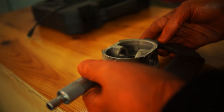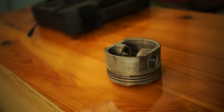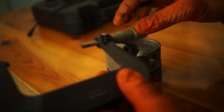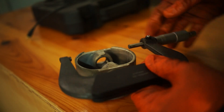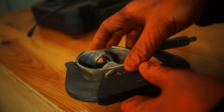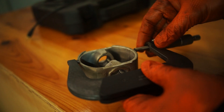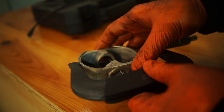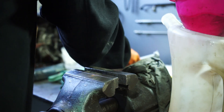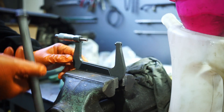I measured these pistons at about 81 millimeters exactly, so there is no massive wear on the pistons — if you had 0.05mm of wear, your piston-to-wall clearance would be excessive. I don't really need to replace the pistons based on wear, but piston number one is damaged, and these pistons are only available for the black top. They are a bit different from the silver top pistons, so I'm going to replace them with black top pistons, which offer a slightly higher compression ratio. Since I'm modifying the head, the overall compression ratio will remain about the same.